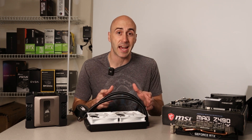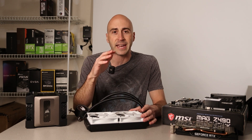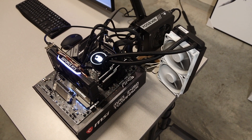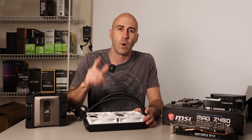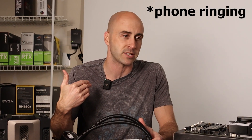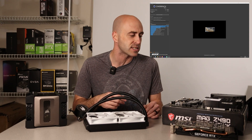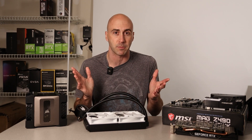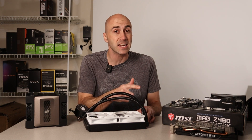Let me explain how I diagnosed my friend's computer once he brought it to the studio. I took his liquid cooler completely out — the fans, the cooler, the pump, all of it — and installed an air cooler to test the AIO on a test bench to see if it was in fact bad. The first thing I did was create a controlled test. One thing you can download is Cinebench R23, from the Microsoft Store. What it does is stress the CPU cores to 100% — all the cores — putting the most load on your processor possible. That'll let you know if your CPU cooler is up to handling all your daily workloads.